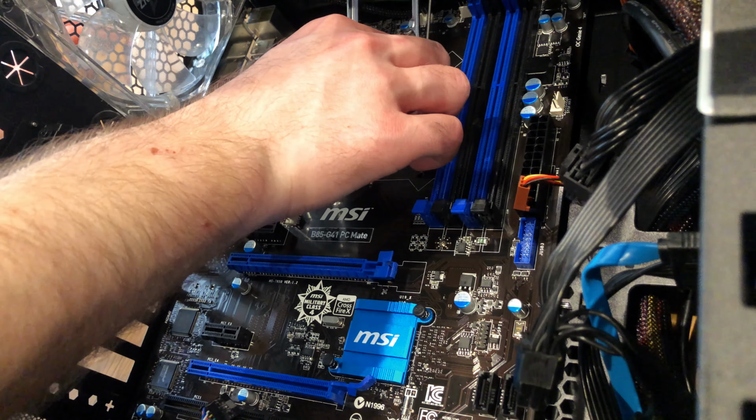And try and keep off the edges, because you don't want any going down the side. So I'll push the old heatsink into position. I managed to get a book underneath, so the base on the other side, I can actually screw it in. And I got a book on the other side to lift it up so that the screws poke through the holes. And then I managed to put the screws in for the heatsink. Now I'm just tightening it up. And there's a kind of satisfying squelching sound when you press down the heatsink onto the processor.